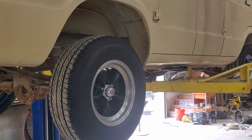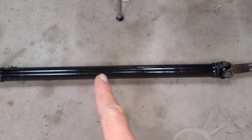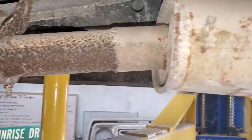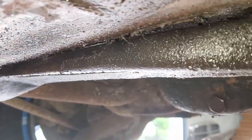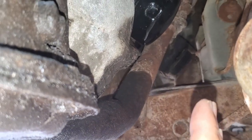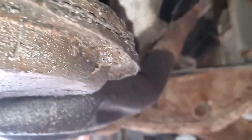Let's figure out why it's not rolling though. Like most of y'all saw on the previous episode, this drive shaft is now straight, because it looked like a spaghetti noodle previously. So that's one thing we've got to install. The exhaust system has really seen better days. The real problem seems to be right here at the transmission - apparently it went and got the pancake effect for that high clearance. So we're going to cut it off and do a junkyard exhaust system with that freeway worth of pipe we got off the Prospector project.